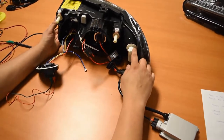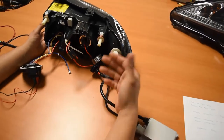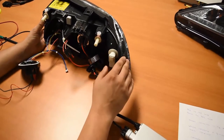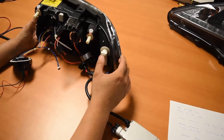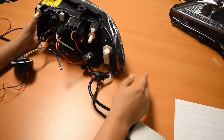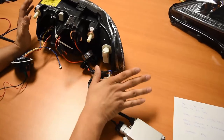One part we've already touched base on — it appears you've already resolved — is the turn signal socket. You will not be able to use the provided one, being that this is for the Euro models, and you will actually have to reuse your US spec one into this socket housing. There is slight trimming that may be necessary just to get it to fit in, but once you do, everything should be okay for this turn signal.